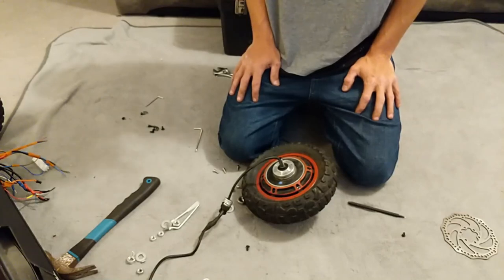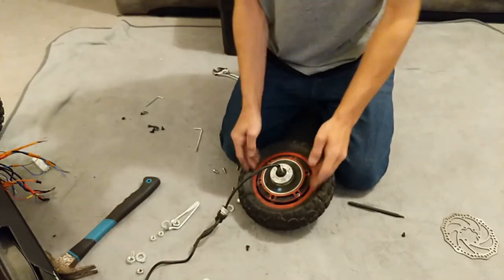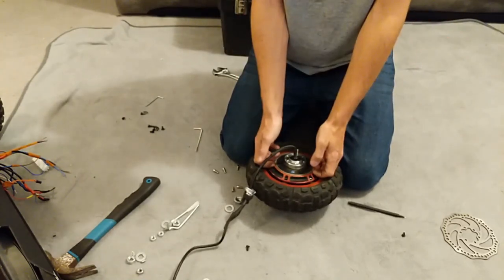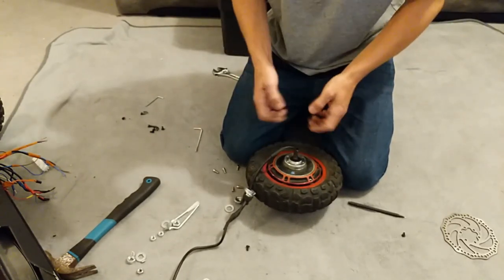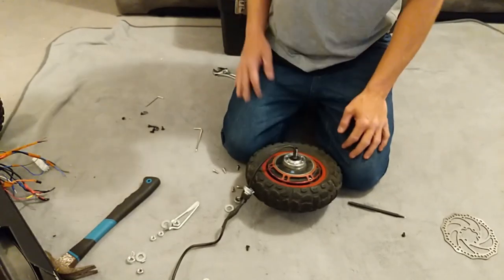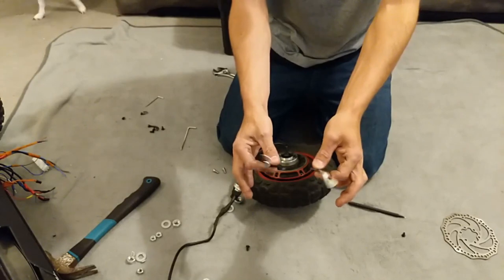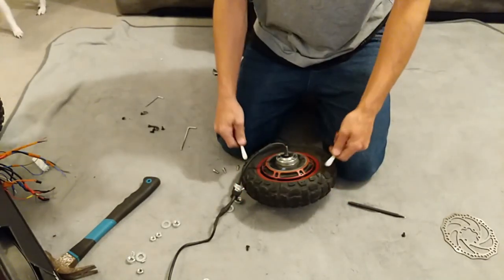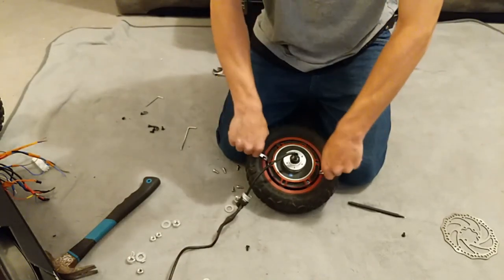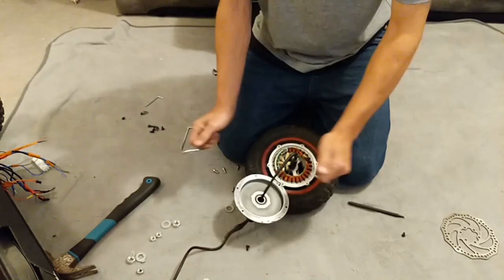This is magnetic, so it's going to want to suck your fingers into the gap. There's a circular disc there — it's magnetic — and we need to pop this disc off without it sucking back down on us. You either go all or go nothing, because if you give it a little bit it's going to lock your hands back down. You can get a bit of leverage using tire levers, knife handles, two spoons — anything to take your fingers out of there.